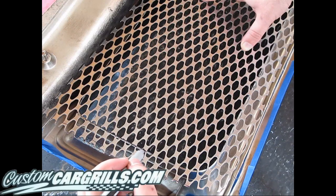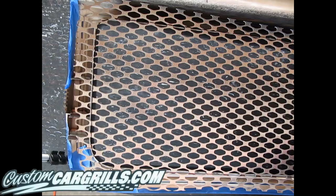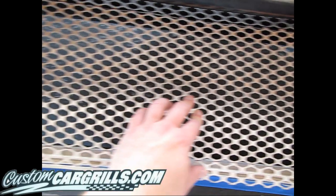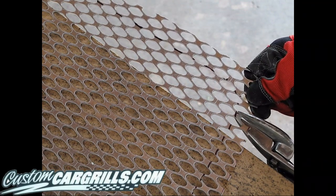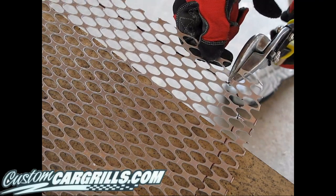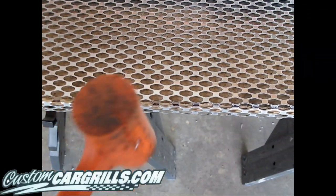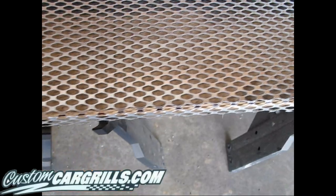After we get done bending it and putting it back on, we're going to use an adhesive to glue it on. You'll want to take your time and make sure you get a really accurate line all the way around. I took my time to make sure this is going to be as accurate as possible, because after the next step there's really not much going back. When dealing with corners, I like to make a couple of cuts — in the long run this will save you time and make the material more manageable when you try to bend it. Depending on the shape of the grill, you might need to make a wood template. In this case they were relatively long, straight, flat lines, so I just used a straight cut piece of wood and bent the material where the line is with a dead blow hammer. This is generally a really good tool to use with this material — it's not going to damage it and it's going to be relatively effective.